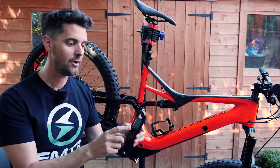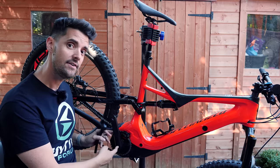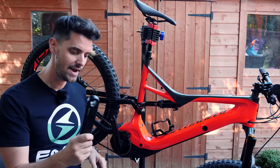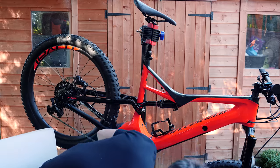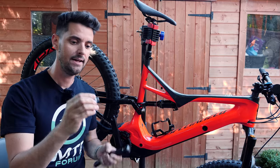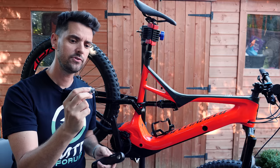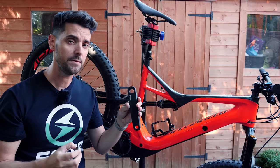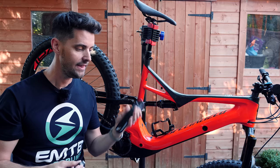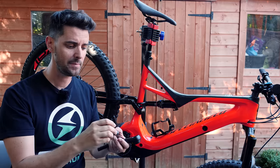It's a ISIS mount that you get, so slightly different to the standard bolt. This is a self-extracting bolt on the standard cranks. These aren't self-extracting, so you do need to make sure you order some bolts. These are standard 21mm ISIS crank bolts — you don't get them included, or I didn't where I ordered them from. I'll put the link in the description. They were £60 and the bolts are about £5, so nothing too expensive.